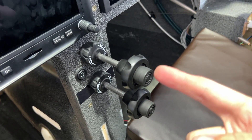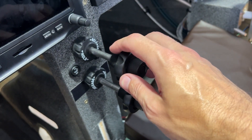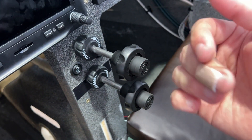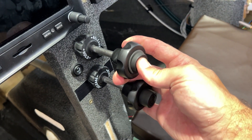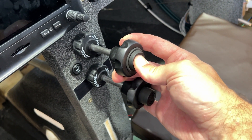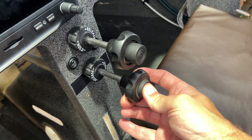When I installed this, my cable does a full 360 degrees around, and the type of cable I got has a little bit of play if you bend it that much. You can kind of see here — if I move it this much, it doesn't actually move the throttle or the mixture back at the engine. You can imagine that makes it pretty difficult to fine-set mixture or throttle.